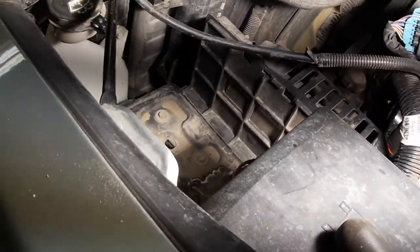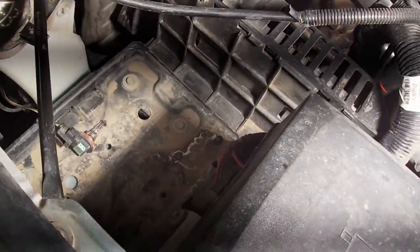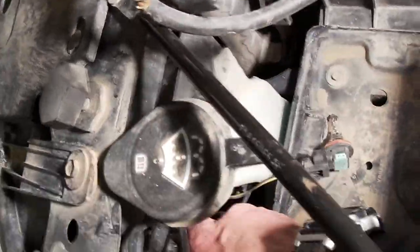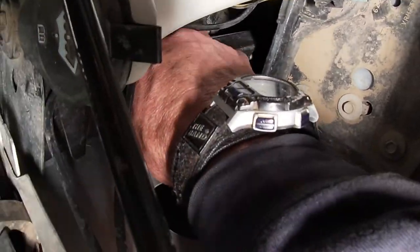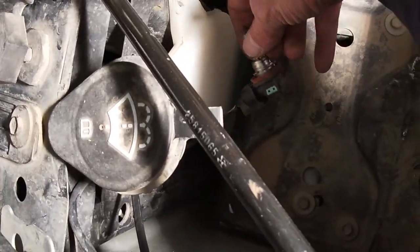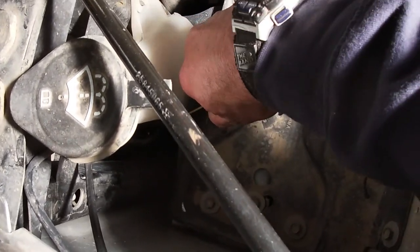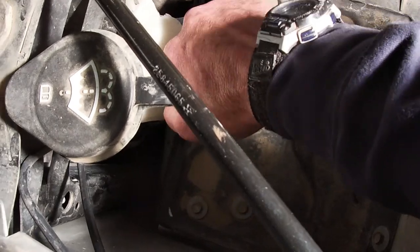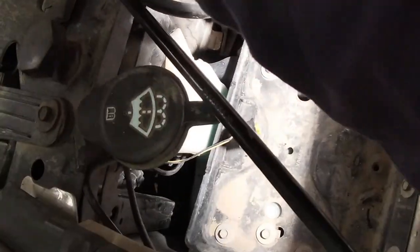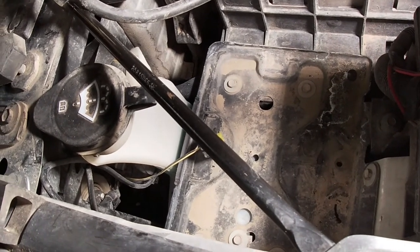So then this windshield wiper fluid reservoir is kind of in the way, but you can reach back in here, in between the windshield wiper and the cowling here, and you can get to it. There's the wire and the bulb. Pretty simple. You just push down on the back here. So I'm going to do it one-handed. Just a clip. Pull it out. There's the bulb. We'll clip the new one in and complete that. So we'll be back when that's done.